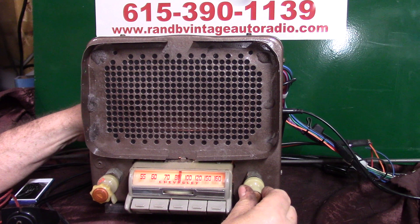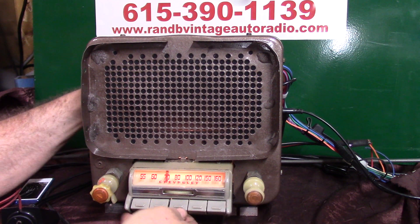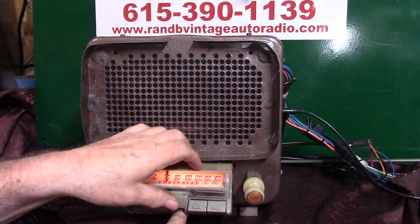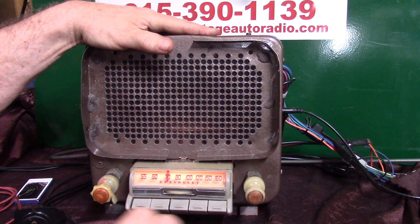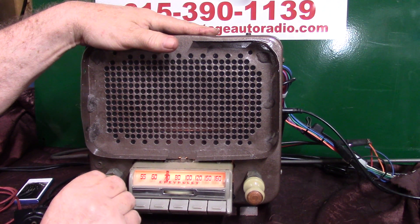Now presets — let's find a station and set a preset. Find one, and then pull your knob up; this little deal pulls out — unscrew it, push it in to set the cam on it, then pull it back out, tighten it up, push it back in a couple of times, put your knob down. Now we've got it set and it'll go right back to it. That's how you set your presets up — it's string-driven.